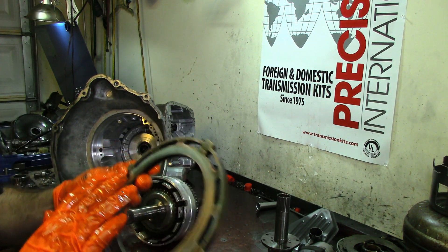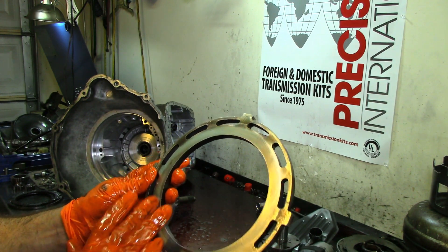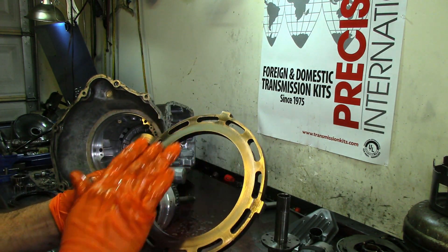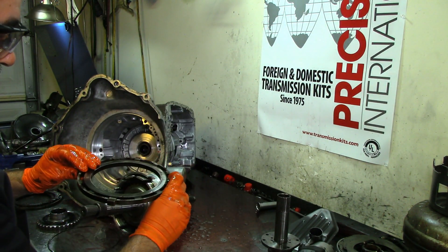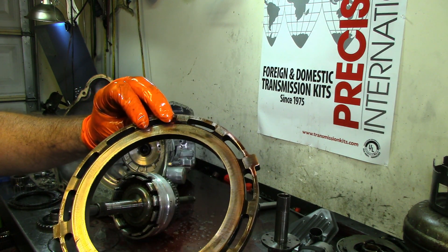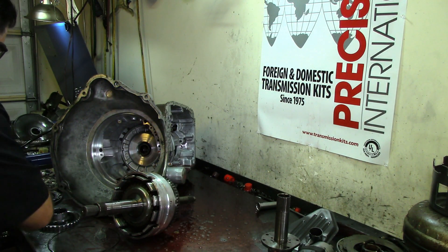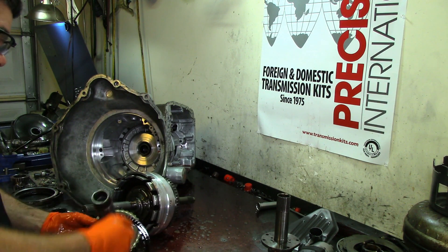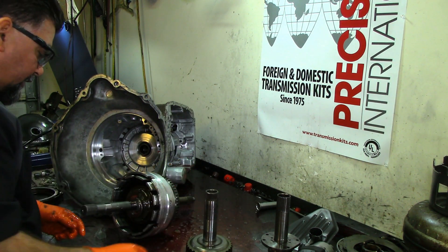You can see right here where it looks like this lost reverse and it scratched the plate a little bit. You can use 3M buffer or gasket remover to save this plate. On the overdrive side they did the same thing — you can see it's a little black. My suspicions are correct: the overdrive frictions are smoked.